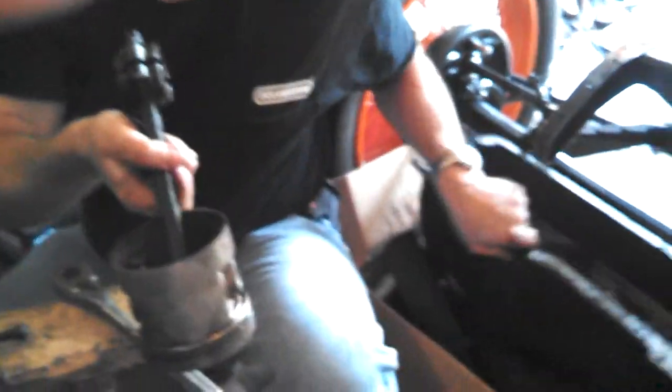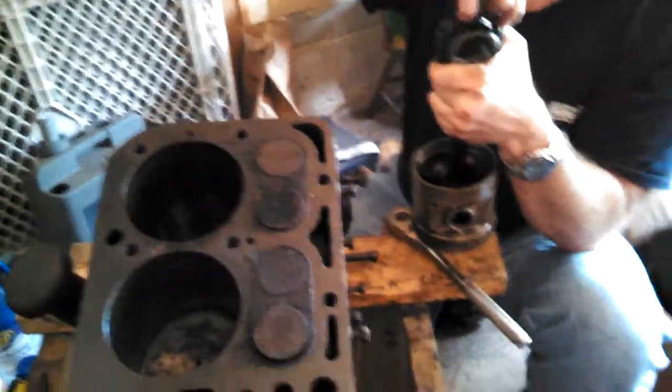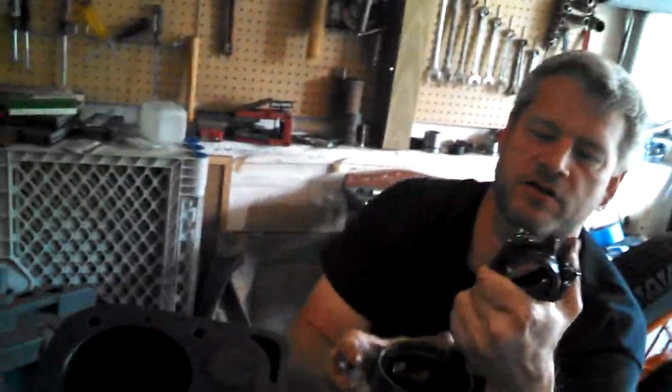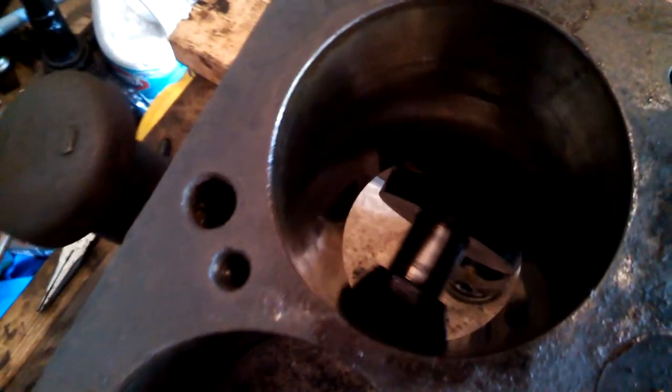In this super old engine, this comes down into a little pit — we talked about those little pits — it actually scoops some oil up and blows it up inside. That's how they keep this bearing oiled. In modern cars the crankshaft has a hole called a journal with high-pressure oil going in it. The metal is never actually touching the bearing because the high-pressure oil sprays out so hard, preventing contact. You can see the crankshaft — the crank — going around down in there.